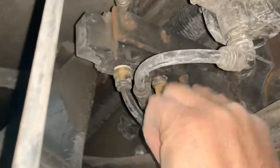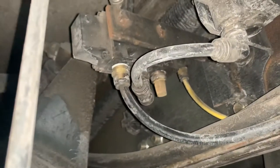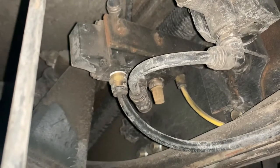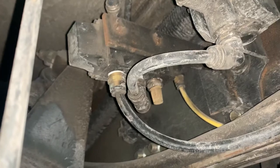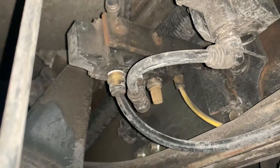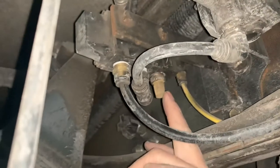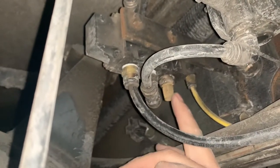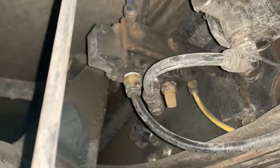You can see this little yellow line — that's what used to be my fifth wheel switch. That is what activates this over-inflate valve. I just use the fifth wheel slide switch on the dash, flip that, and it over-inflates. This is where it drains, and they recommended I put a little filter on it so that debris can't get up into that port. So I did that.